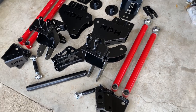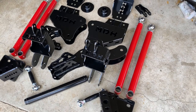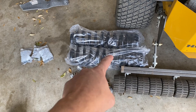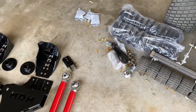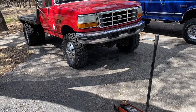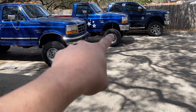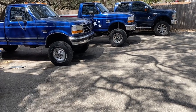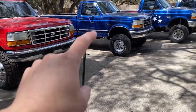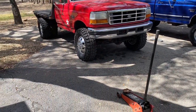Right now this is one of the first kits going on a customer's truck. He doesn't currently offer it with lift springs, a pitman arm, or shocks, so you have to buy all that separately. We got some Icon springs — these are for an '05-plus with a two-and-a-half-inch lift. We're trying to make the dually match the '96, which has about four-and-a-half inches of lift, so with the two-and-a-half-inch OBS spring we think we'll get pretty close.